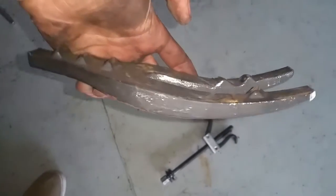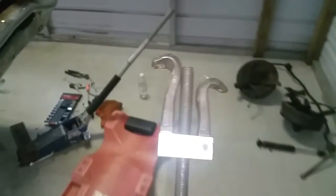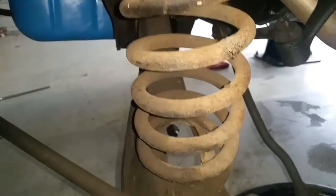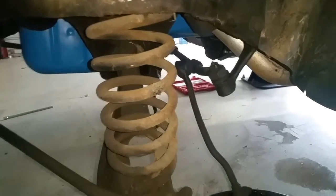This is the spring compressor tool. It consists of a bottom fork with ridges for different size springs, and a really heavy-duty piece of all-thread with a cool block with hooks on it. I'm just going to grab on to the spring — you put it in through the bottom and these hooks are going to go up to the top part of the spring. The directions state to put your fork and your hooks closer toward the middle of the spring, maybe this spring right here, or the second spring from the bottom.